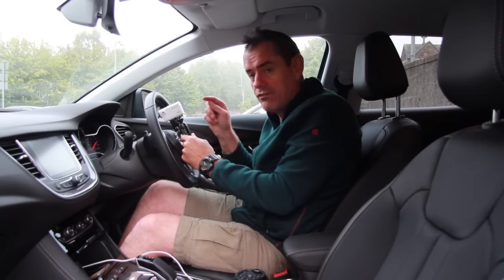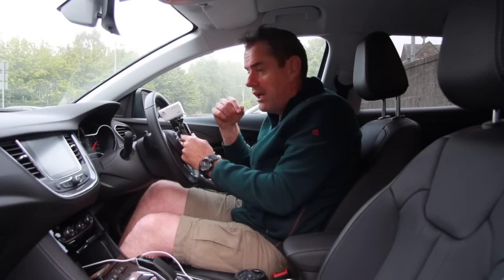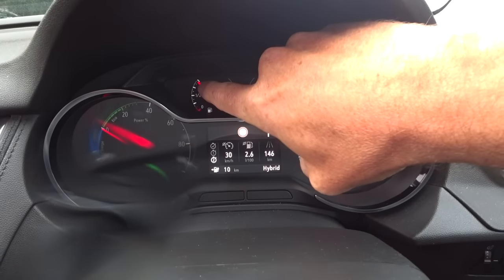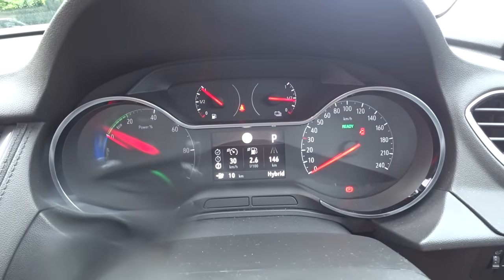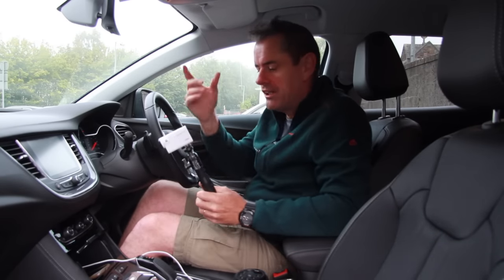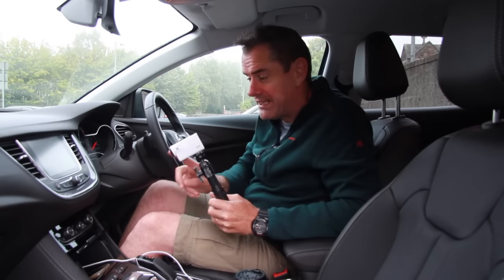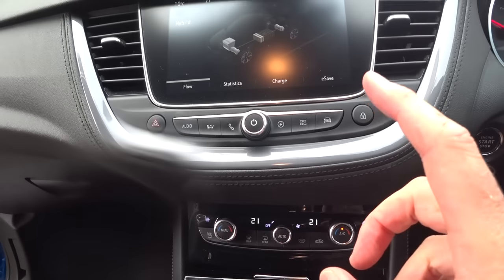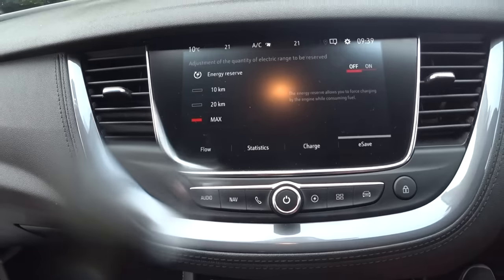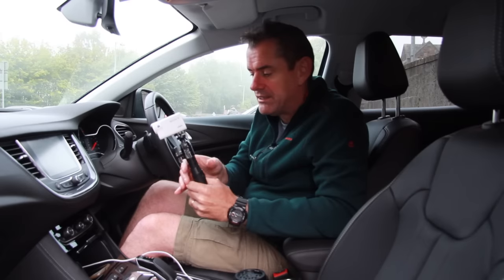I could have got that lower, but I actually drove this car from Dublin to Portlaoise on the motorway at 120 km/h. Look at the fuel tank — nearly empty. Just think of how efficient this car is. The engine shut off again because I've got 10 kilometres of range left. You can go into the system here and turn on e-save, which lets you reserve energy. If you're going to be on the motorway, you turn on e-save and you can save around 20 kilometres of range for the other end — great for low CO2 or congestion zones.